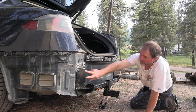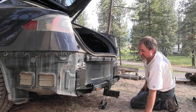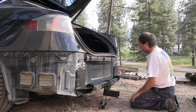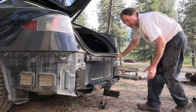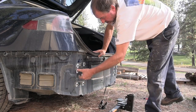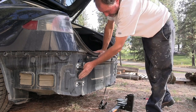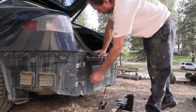These four bolts already had a washer on them, and if I push the hitch in on them it sticks out on the bottom — so that's not a good thing, something will have to give. In this case, I think I need to remove the washers that were there from the factory. There is a little lip right here, so that's probably why they were there, but right now they're causing an issue so I'm going to remove them.